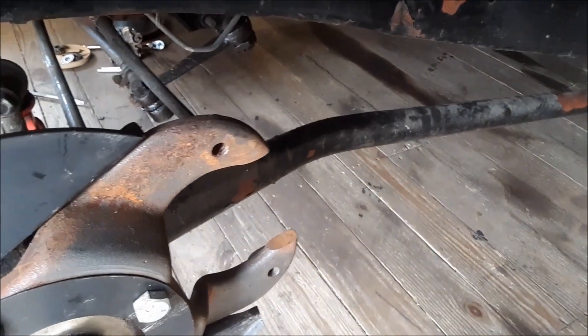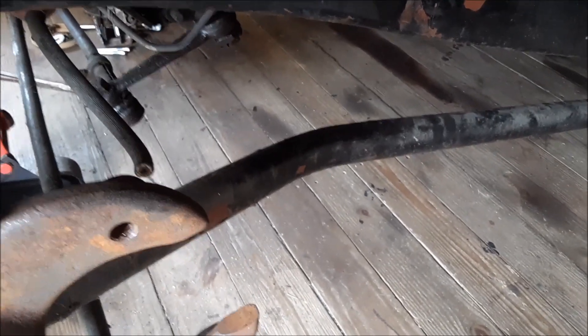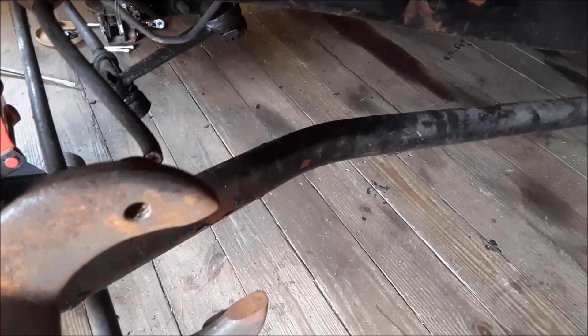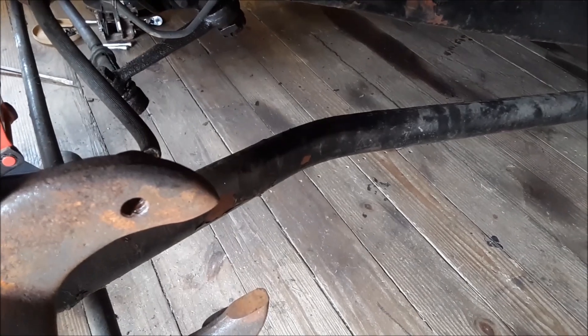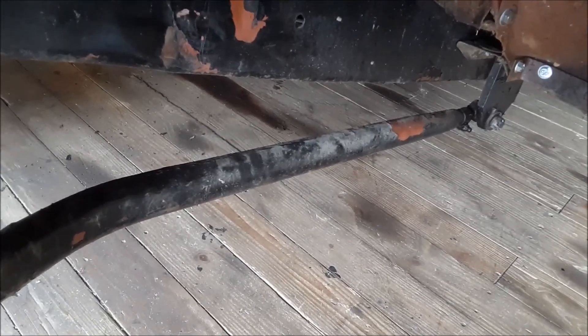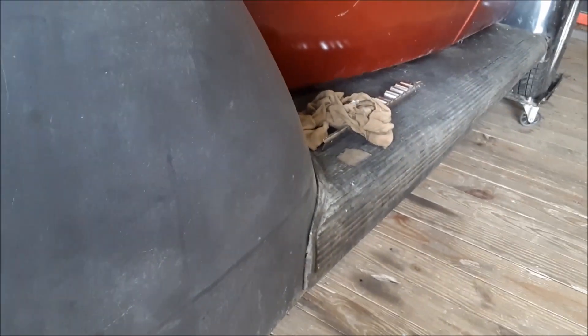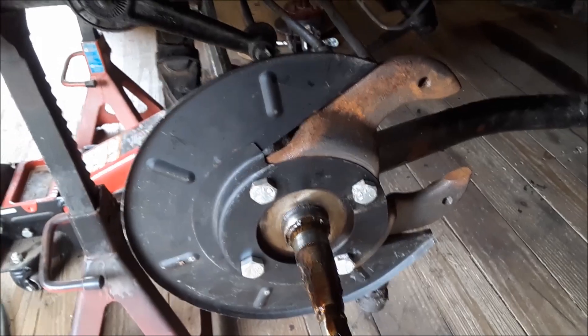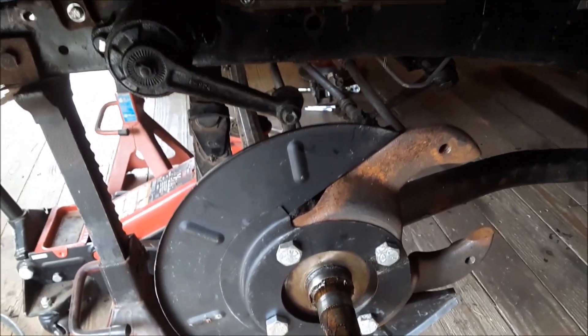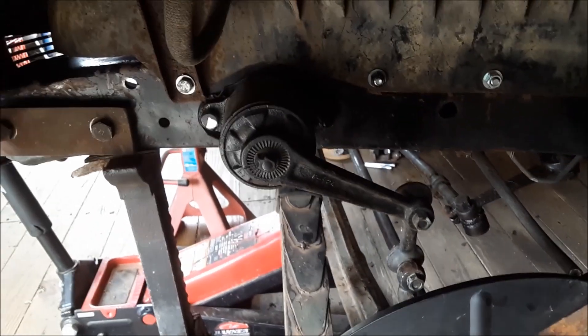You can see here the old wishbone — how they did those back in the day so that the tires had clearance. When you turn the wheels you had clearance on the tires, and they'd hook them to the side of the frame. I had to alter the running board — I had to cut a little slot out of the running board up in the front where it bolts up to the frame so I could get that on flush without having to re-drill any holes.